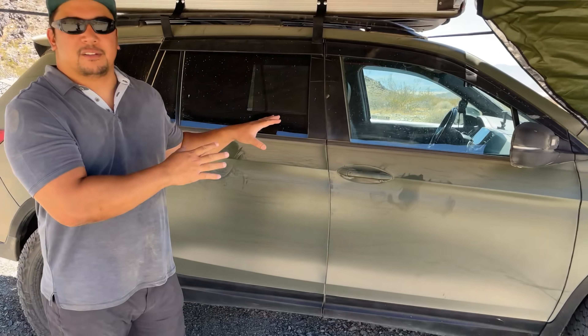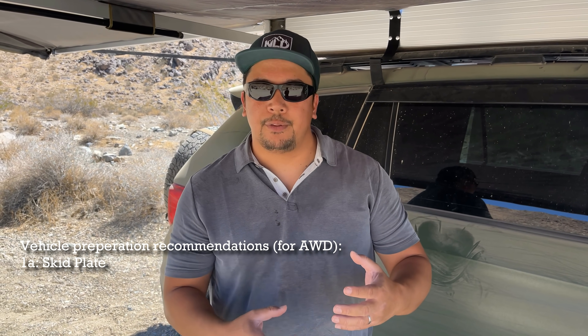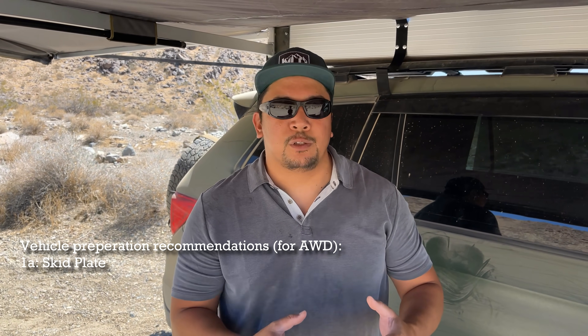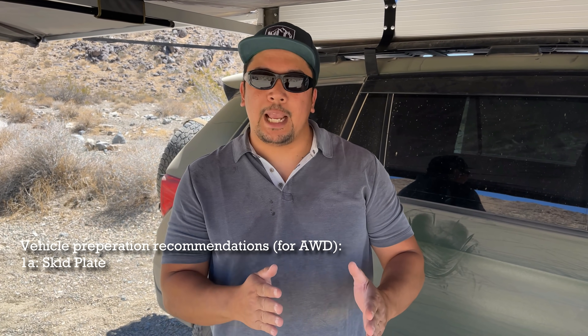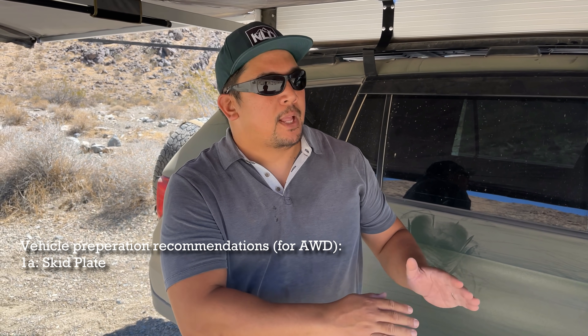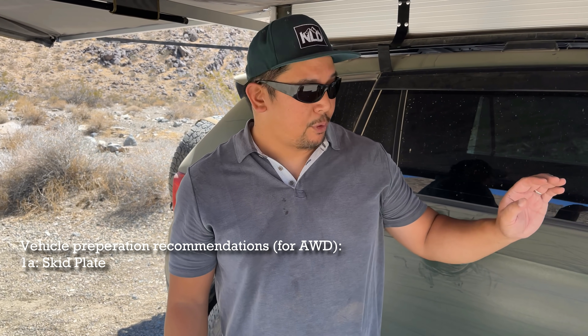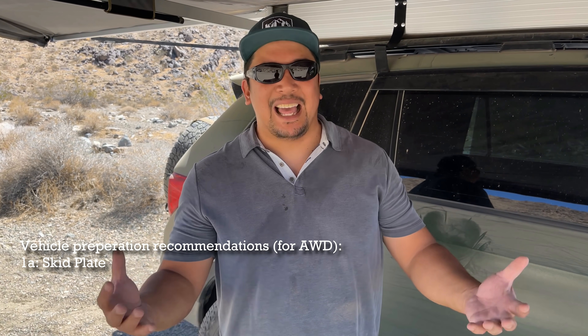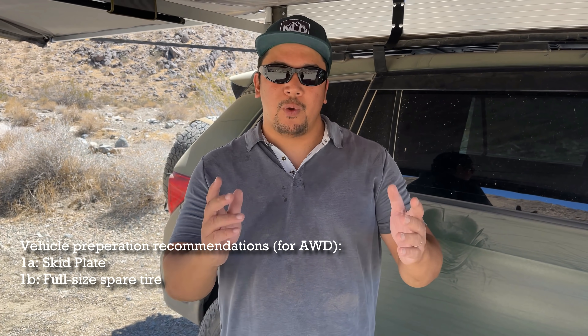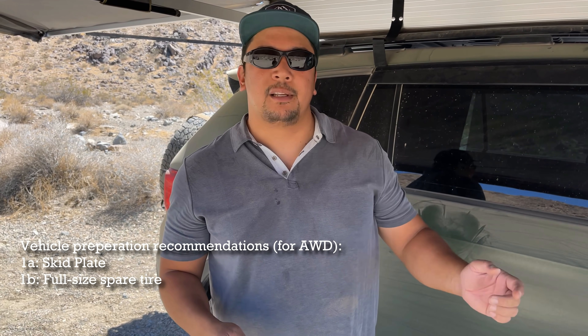First upgrades — and we're talking about all-wheel drive vehicles. Number one: I am going to say skid plates. The reason is if you're new to all this stuff and you're using too much momentum, you haven't quite learned how to choose the proper line, and you smash your oil pan on a rock — that is game over. That is going to be so incredibly hard to repair compared to a flat tire. If you had to choose between the two with an all-wheel drive unibody, I would say skid plates, hands down.